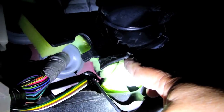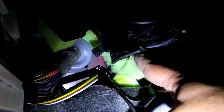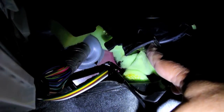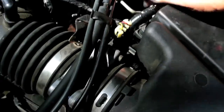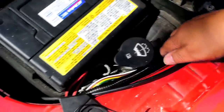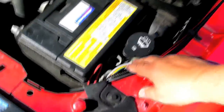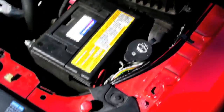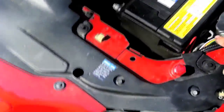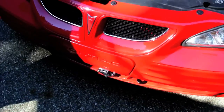We're now done with the gooping. I just gooped where all the cables go through the firewall. Now we've dressed off all the cabling. Here's the wire loom going through here, and it snakes under here and comes out here. I've got the ends of the wires exposed still because the next step is I have to put this up on a ramp, get under the front of the car, and run these cables to install the breakaway.